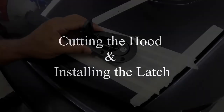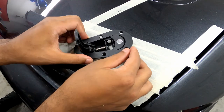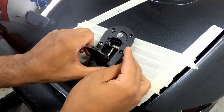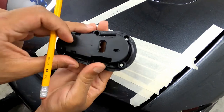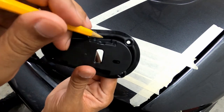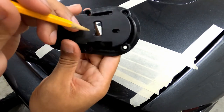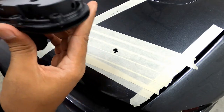The anchor can be rotated 360 degrees, so you can orient your latches however you want. The important part is to make sure the anchor aligns with the locking pin. What I did was mark the sandwich plate that comes with the latch with a pencil — I marked it where the slots for the lock pin are. This gives me a visual reference on where the anchor and slot should line up.